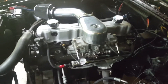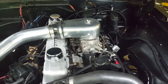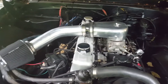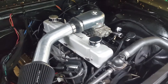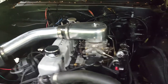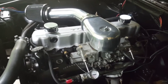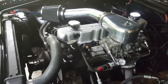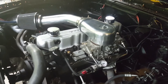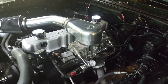I'm mostly interested today in transfer slot configuration, because it was originally set in the 30 to 40 thousandths range so the little transfer slots were square like they should be. However, I've played with the idle and timing so much that I think I've actually got them too large now. The main issue I'm troubleshooting is a lean bog on initial acceleration — it's not horrible, but I need to be careful or I can get a backfire. So I'm going to pull the carburetor right off and get a better look.